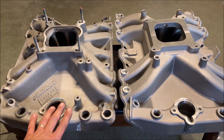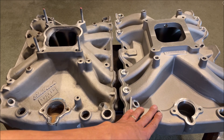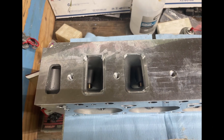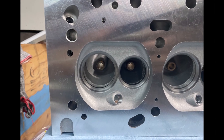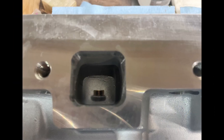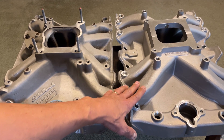Speedmaster has come on the scene and taken the market by storm. They make aluminum cylinder heads that are very affordable — not great out of the box, but a great starting platform. Especially if you're building a typical GM, like an A-body Cutlass or a G-body Cutlass, and you want to start going a little bit faster, a single-plane intake is the next step. Single-plane intake is better for higher RPM.